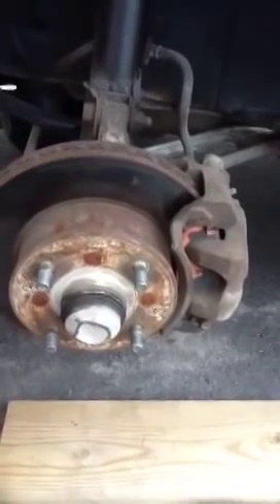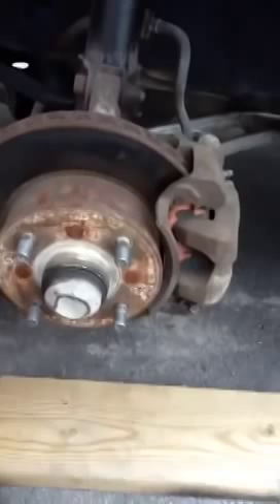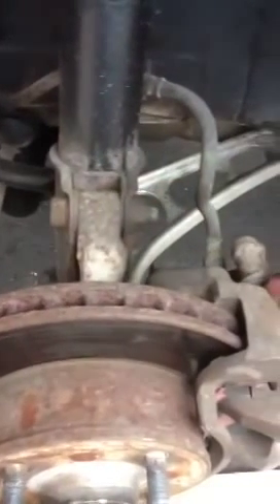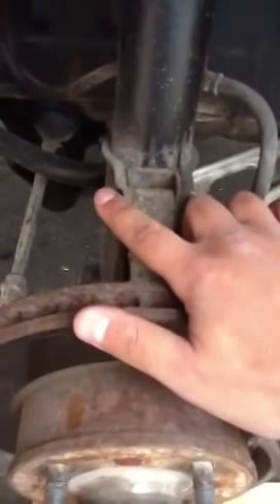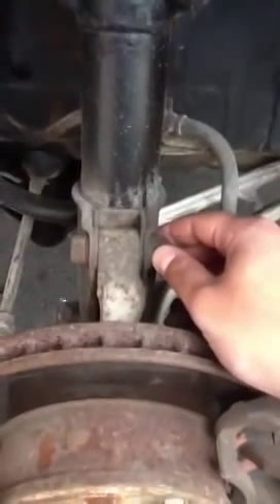There's what it looks like with the wheel off. As you can see I still have my 4-lug and NA calipers — eventually I will do the swap on this and put the T2 stuff. Note that the bolt goes in on the outside and the nut is on the inside between the caliper and the shock. You want it to always be like this or it's a pain to get an impact on here — always put it back the same way or you'll have a pretty bad headache.